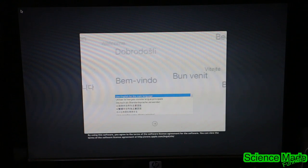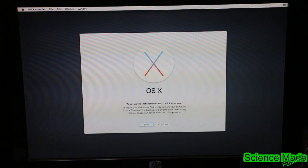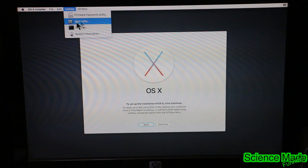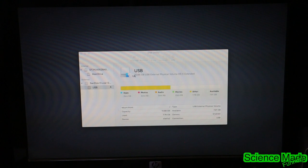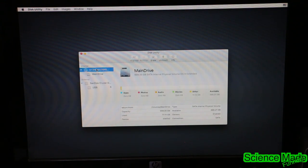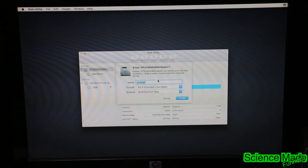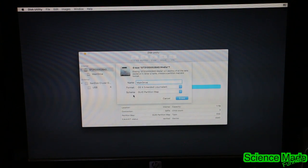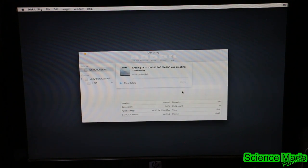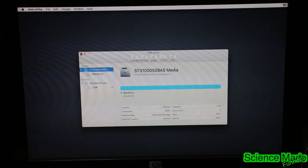We are done — here it is, all booted into the USB drive. Keep in mind you might need to use boot flags to get to this stage. Choose your language as English and hit Continue. Instead of continuing through, go to Disk Utility. Then go to your main drive — not your USB drive but your main one. Hit the Erase button, rename it to Main Drive, set format to OS X Extended Journaled, and GUID Partition Map. Hit Erase. Just make sure you have no data on the drive you are erasing because you will lose it.